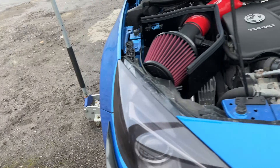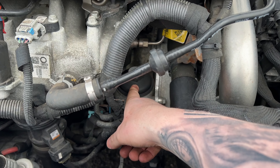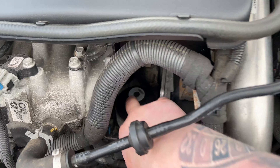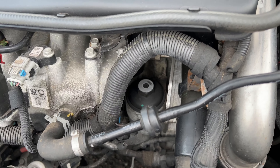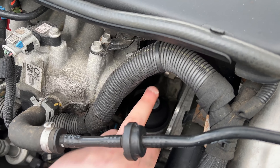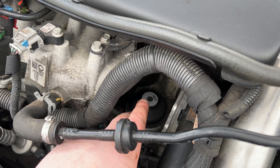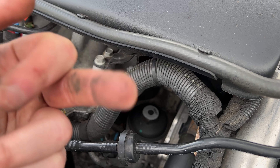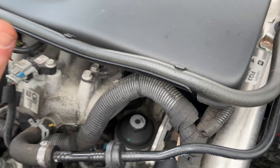Last time I was lying under the car I hadn't undone the support bar nut, and oil ran down it right onto my face. So take that support bar off before you take the oil out. Coming up to the top - obviously oil goes in there. Your filter's down here. I'm going to crack the filter cap off first to let all the oil inside there go down to the sump - my dad says undo that and the oil will go into the sump.